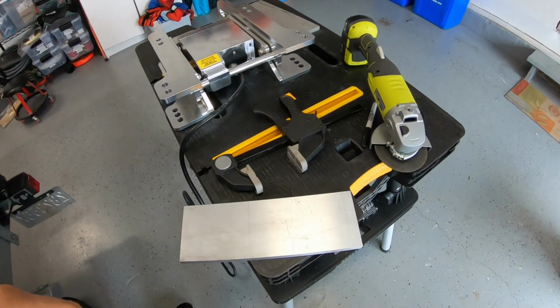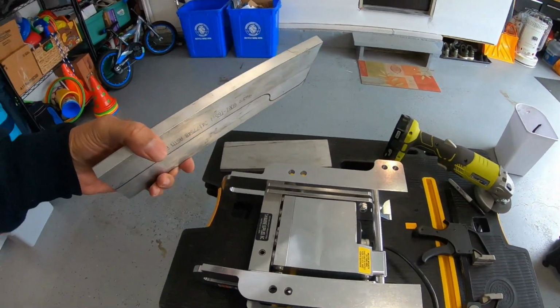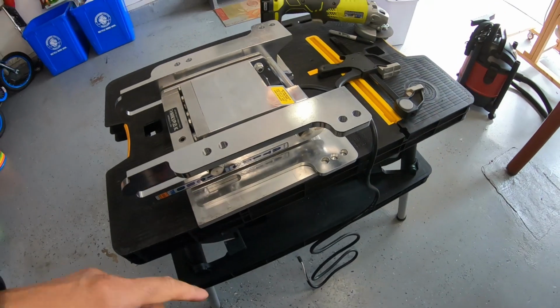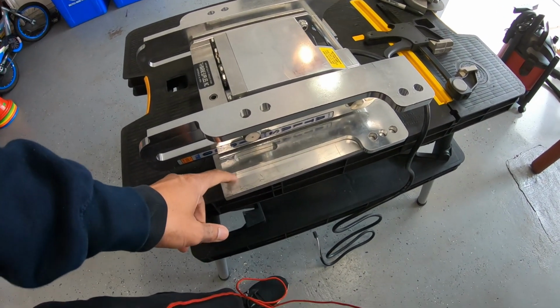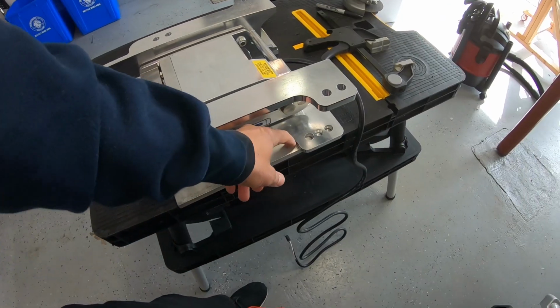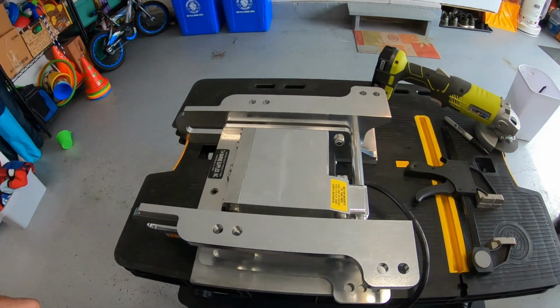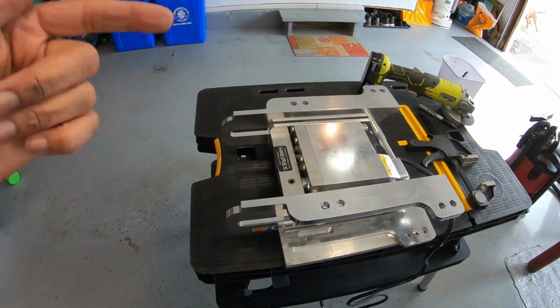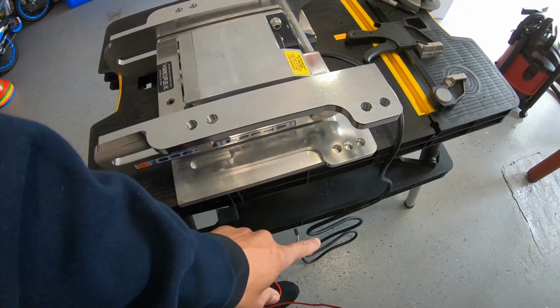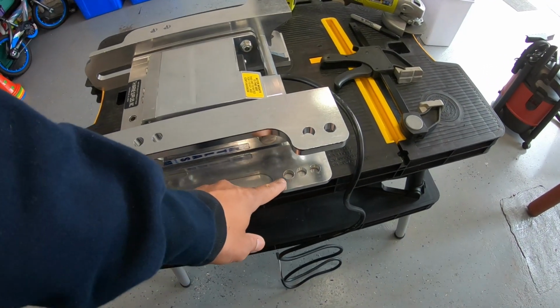I went to my local metal shop and picked up 2 pieces of aluminum sheeting. This is 1/2 inch thick. And because these plates are a little bit heavy, I'm gonna take some time to cut away a little excess aluminum that'll be sticking out. Also, just to be a uniform shape along with the jack plate. You know, weight adds up really quickly, and on small boats, weight matters. I can't stress that enough. I'm gonna go ahead and trace this out, cut off the excess aluminum. I gotta drill some pilot holes right here.